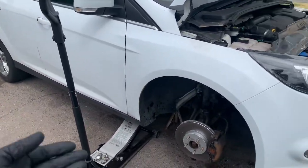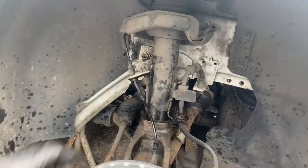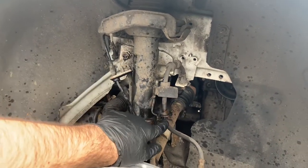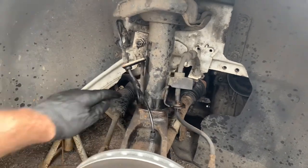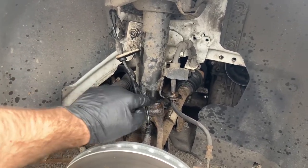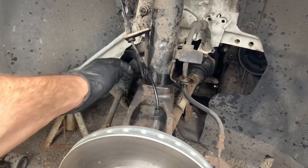As you can see, the car is already jacked up, the axle stand is already under the subframe, and I've removed the wheel. I've also soaked the drop link of the anti-roll bar a little bit, and also this bracket here where the brake hose attaches. I wire-brushed everything and then this collar here, and put some WD-40 to let it soak for a bit, then put a little bit more in order for it to seep into the collar of the suspension strut.